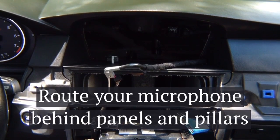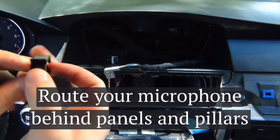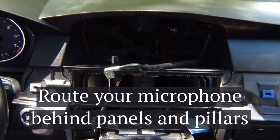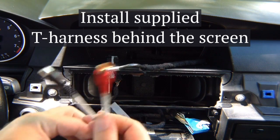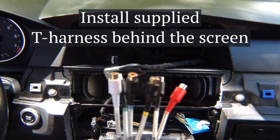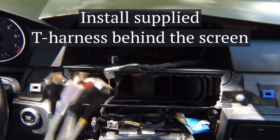Whether you install Apple CarPlay with Android Auto or smartphone mirroring, the wiring harness installation is identical. For Apple CarPlay you will need this microphone — it has a clip and clips to the headliner from the back, hidden inside. You install the plug-and-play harness, route the microphone through the side of the car. You've got audio output RCAs that connect to the car's auxiliary jack. You've also got four video inputs, but you're only using two — either a DVD player or front and rear cameras.